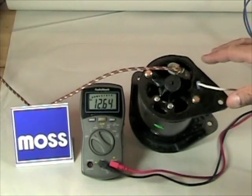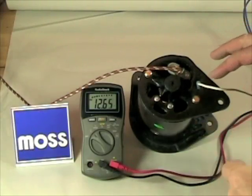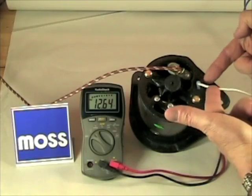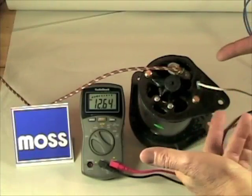A generator is a simple device to test. Under normal circumstances, when the motor is spinning and the generator is spinning, the voltage regulator puts power into the field magnets via the field terminal. The magnets become excited, and the generator makes electricity by working with the magnets.